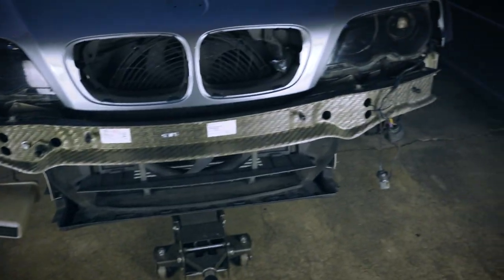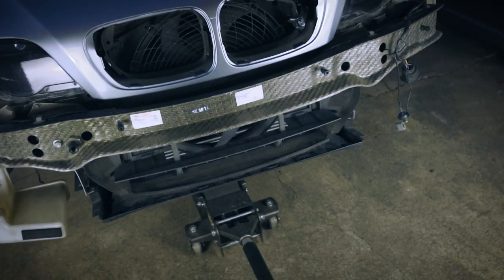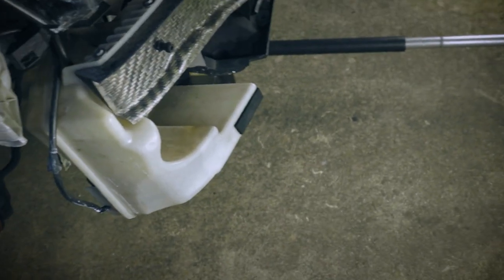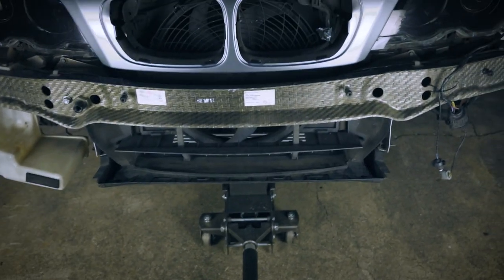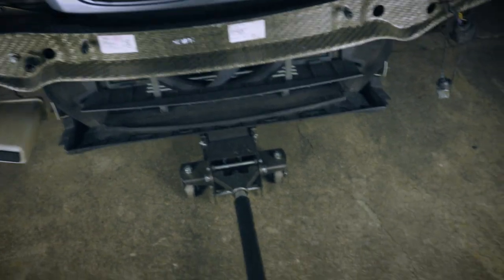Getting ready to install the front bumper, but what we have to do is remove this carbon Kevlar crash structure support, and there are a few bits we have to remove from it while we're removing it from the car. There's a different reservoir tank, so we have to install this onto the other bumper, but I have a different one that goes for the CSL front bumper. I'll leave the part numbers for all the parts required to swap from the facelift model to the CSL front bumper in the description below so you can buy them if you're doing this.